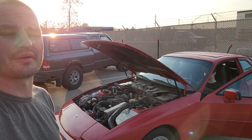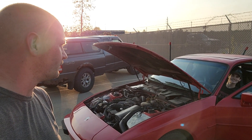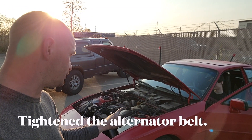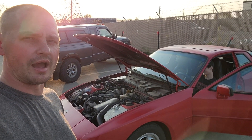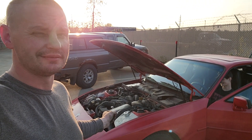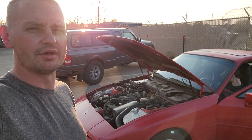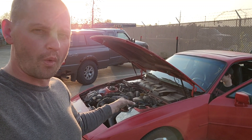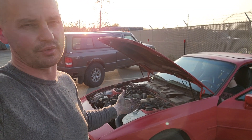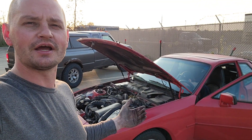It's running but with a rough idle — that's not normal for this car and will be one of the next things to address. Battery voltage is going up so we are charging and no belt squeal. I'm going to call this one a win. I don't know if we'll make it home because the coil isn't 100% perfect, but we'll take it straight home and either find the correct coil match or make a custom wire from the coil to the distributor with the correct ends. Either way we'll make it work. The Ford runs again — thanks for watching, please like, comment, and subscribe.